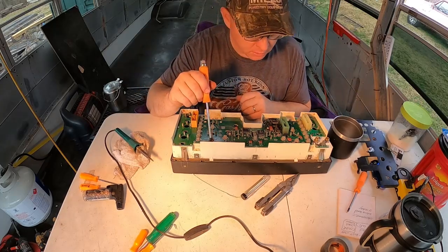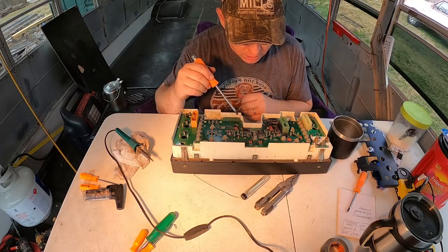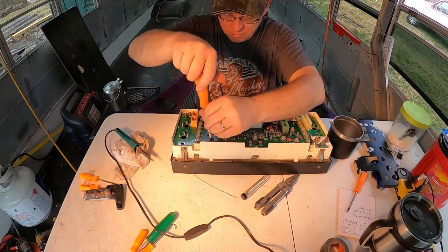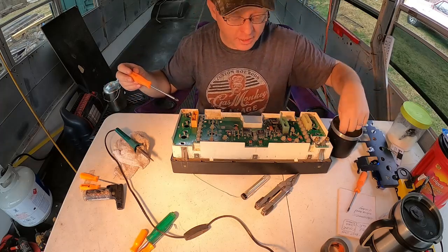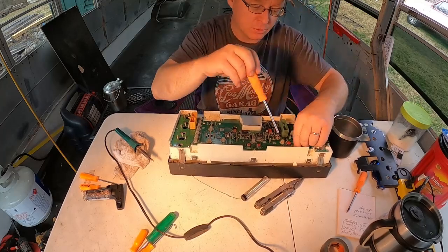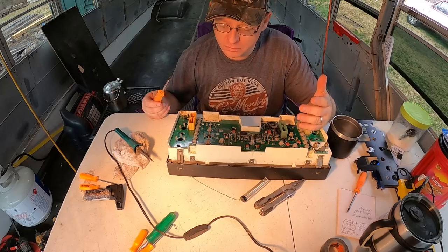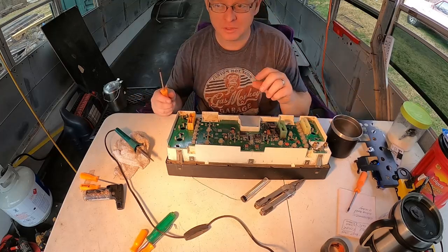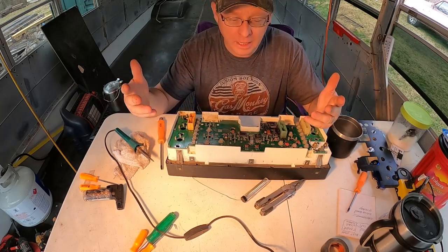We've got a screw right here, one over here, and I believe that should be it. I'm gonna look around, make sure there's no other screws holding it in, but I'm pretty sure that's it. So we're gonna remove these two screws here. They look like they're exactly the same as all the other ones I've been taking out, so we'll just go ahead and mix them in there. Always be mindful of that when you're taking something like this apart, of different length screws and stuff like that. Keep them separate. And if you have to, put them in little baggies in case you forget, which I always do. It helps if I just have little sandwich Ziploc bags, and I can take a Sharpie and write on there where it came from, what it went to.